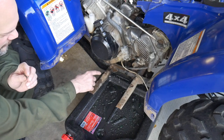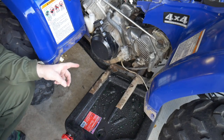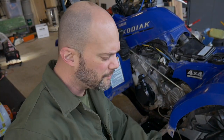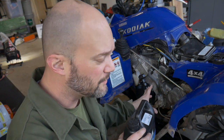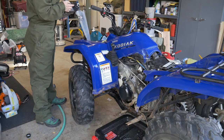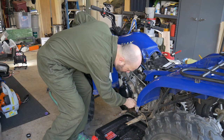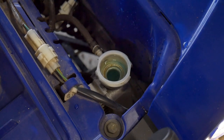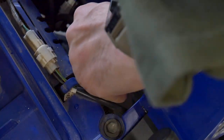What I'm going to do is leave this open and pour the first bit of coolant. When it starts turning blue, then I know I've worked everything out of there. Actually, I'm going to run it through some distilled water first. So I'm going to take this Yamaha blue coolant and fill it up in the radiator, but I'm going to leave this overflow plug open until it turns blue, then put the plug in. There it goes — now I know I got most of that water out of there.